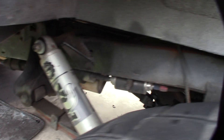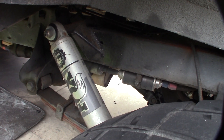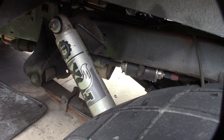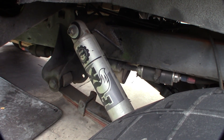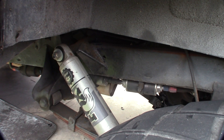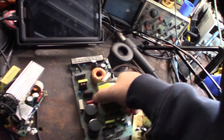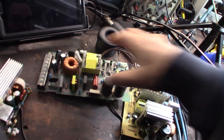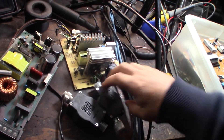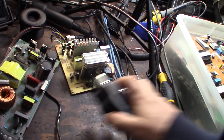The fuel pump is right there — it's a hidden thing. I have the negative going right to the frame ground and the positive going up near the radio, but I have a ferrite on that too. I wanted to put a capacitor on the positive and negative leads right on the fuel pump — people said it can actually help. At this point I've put chokes on the back of the antenna, even designed Mix 43 and Mix 61 chokes. These all actually help, but so far no single thing has fixed it perfectly.